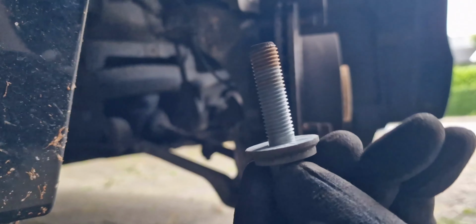And that's why it's really recommended to make sure that here is clean. And also, if you're going to put the brake disc here and it's not really straight, the tire is going to wobble when it's driving. So make sure that it's clean. You can clean also with the brake fluid cleaner, and wipe it with a smooth cloth. Everything is clean. I just wiped it with a cloth completely, and also make sure that inside is clean.